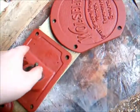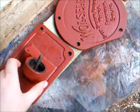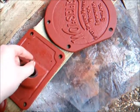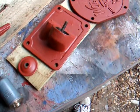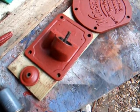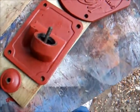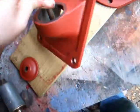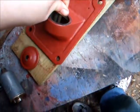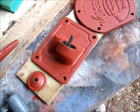I was quite surprised how easy the tag is to remove off of this crankcase door, sort of inspection cover, slash for the oil filler and the dipstick there. I've seen loads of ones where people have had to mask them off to paint it. But I just took mine off. On the opposite side here, the holes go straight through. There's two little sort of like pins, and if you just gently tap on the back of those, they'll lift out, and then you can lift the tag off.